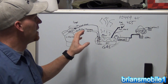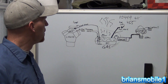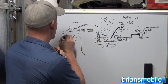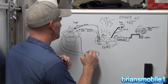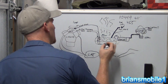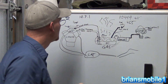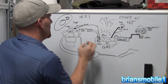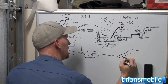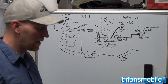It starts really well in the cold — it's awesome. But the downside to gasoline is that it evaporates, you get hydrocarbons, and it pollutes the environment and makes people sick. So we want a way to capture these and reuse them. Your engine exhaust goes through your catalytic converter and it really cleans it up. What we want coming out of the tailpipe: we have hydrocarbons in and a lot of O2 going in at about a 14.7 to 1 air-to-fuel ratio. Out the tailpipe all we should have is H2O and CO2. If you have O2 coming out, you've got an incomplete burn — something's not right. So carbon dioxide and water out the tailpipe — that's all we're looking for.